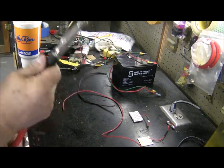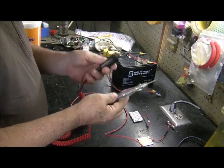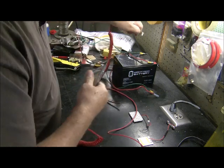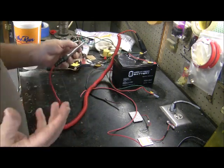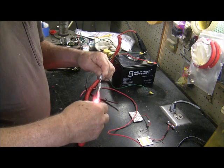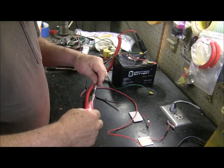Okay, now you ask, well, how do you know which is the positive side and the negative side on the wire? Well, you'll have a wiring diagram, but the easiest way is use a test light, and all the test light does is when you hook this to a chassis ground someplace. This battery just represents the car, and now it's hooked to something metal on the car that should be grounded. Then when you touch the other side to a wire, the light's going to come on and show you that that's making a circuit. So that would be a good wire to hook your lights to, as long as they come on when you turn your parking lights on and they don't flash like a directional signal bulb or a stoplight.